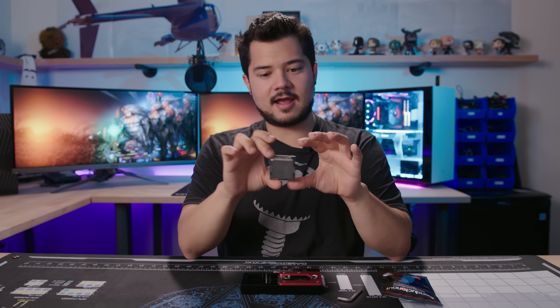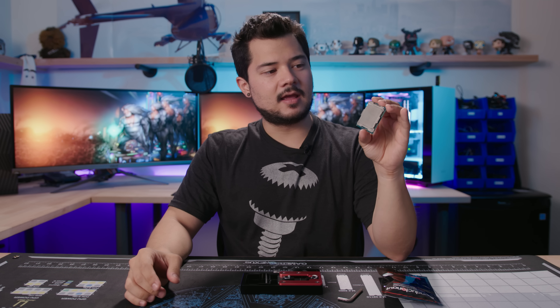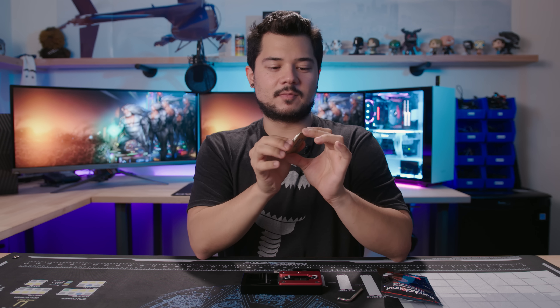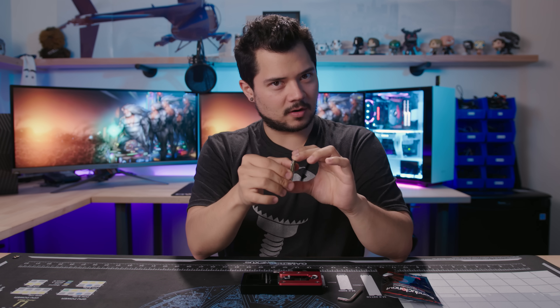When I initially got it back from him, it was working perfectly fine — temps were amazing. It wasn't until a couple months later when I actually drained the loop and took the CPU out of its socket for a good cleaning, put it back in, and refilled the loop that it started overheating. I think in the process of taking it out of its socket, the retention clasp may have alleviated enough pressure off of the IHS to move it around, or maybe messed with some of the liquid metal underneath. It could be air bubbles — I'm not sure. But I'm pretty sure the issue started because of that drain and fill procedure.